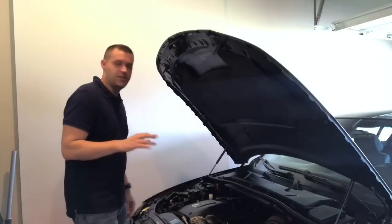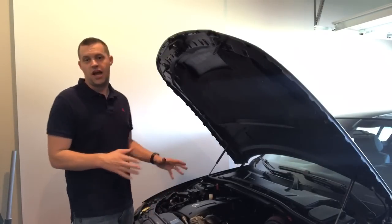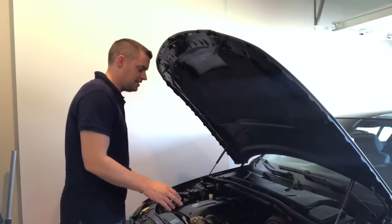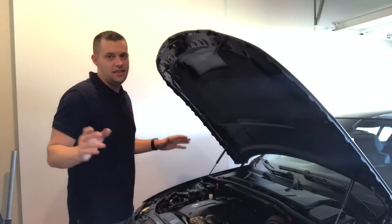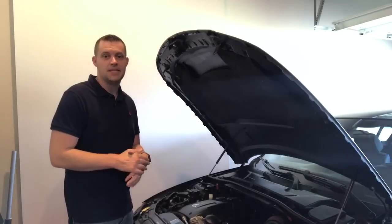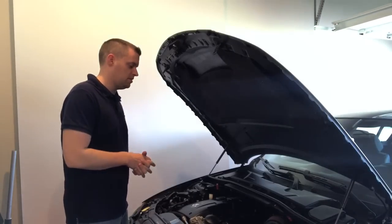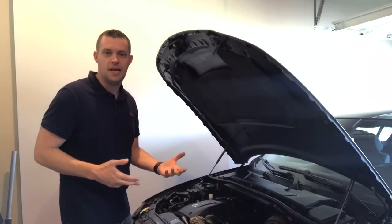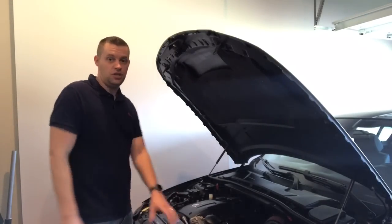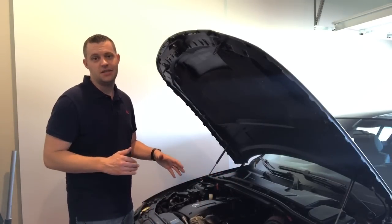Next, I'm going to look at my intake track. I have the five-inch stepped intercooler from ARM Motorsports. I'm going to be checking that because, using stock connections as it is, they are prone to leaking at high PSI. I want to test that and rule it out — and if that's an issue, it's a great time to upgrade. We'll look at the outlet, the charge pipe area, and go through the whole N54 system.